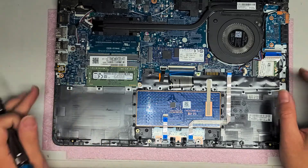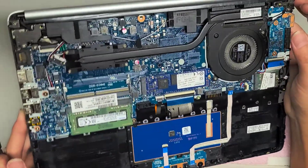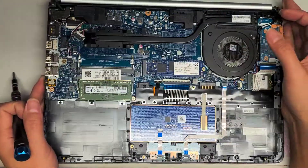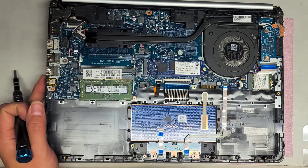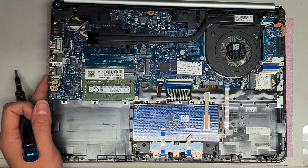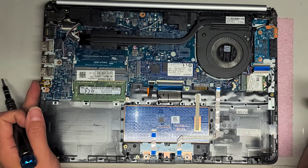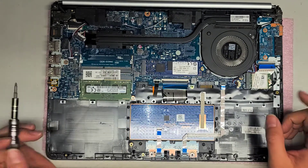Probably just get another 4GB stick. The SSD here looks like it would support a PCIe NVMe SSD, but this is just a standard M.2 SATA SSD. I'm not 100% sure if it will support the PCIe NVMe, but it is slotted where I think it will let you put one in. Sometimes you can put the SSD in but it won't read properly to install the operating system, so don't hold me to that.